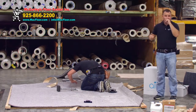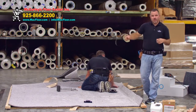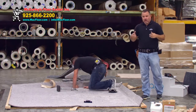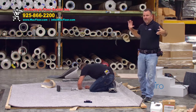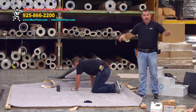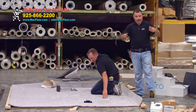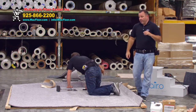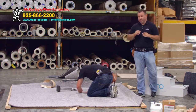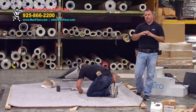As Phil mentioned, once one side is in, since I'm not worried about stretching, I can actually divide the room in half. One of the largest we've done recently was about 25 feet long by 30 feet wide with two and a half drops. We got the first drop in, moved the sectional sofa right on top of it, put the other two and a half drops in, and separated everything back out. For those longer seams, we used the chalk line technique to chalk it and then straight edge it. The mindset of an install becomes completely different.